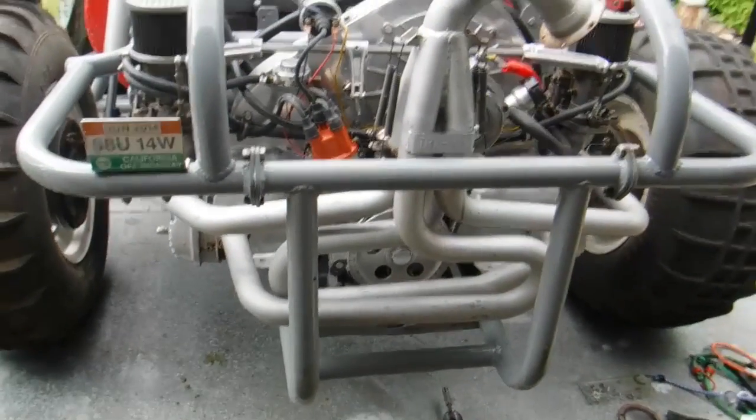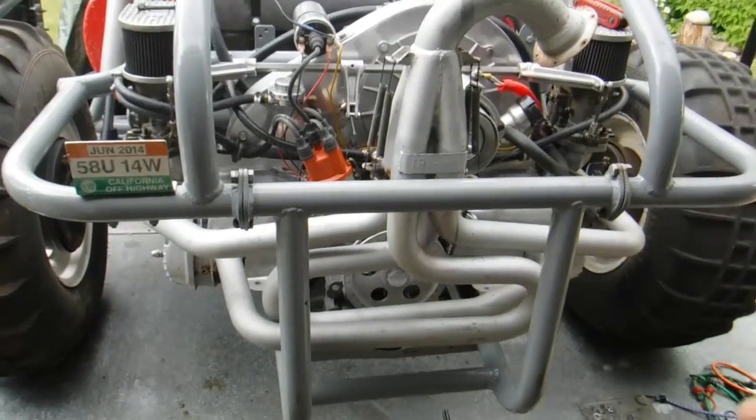We're just in the process of untangling this stuff. I'm not going to say all of this is wrong, because the fact remains this car has been running for years set up the way it has, and that is a testimony in itself to how robust these bigger motors can be under severe conditions. Running around in the dirty desert is very severe — the sand I'm used to running in isn't as bad, because those grains of sand are large and pretty easy to keep out of the engine with a sand seal and a good air cleaner with an outerwear on it.